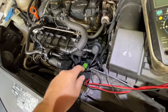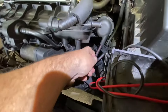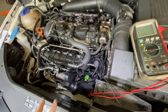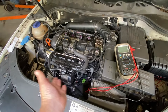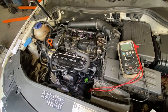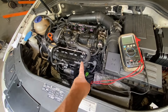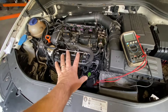It's a big plastic thing and it comes with the valve. It also comes with that sensor and the solenoid over here — see the solenoid? It comes with all of that. Usually the factory ones were a lot of money, $300–$400. Now you can get them aftermarket for like $90 on eBay or Amazon. You put in the year, make, and model because they're a little bit different — some have a vent on the solenoid, some don't — and you get the proper one for your car.